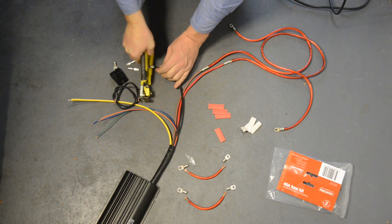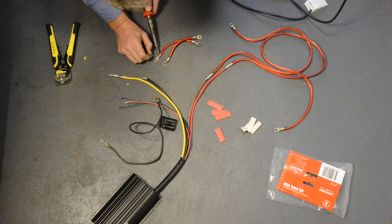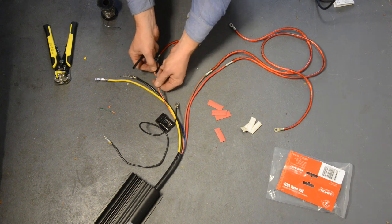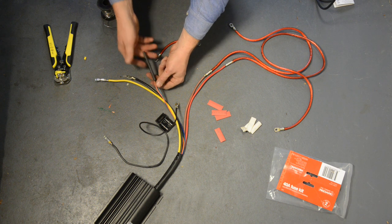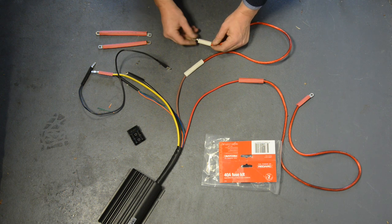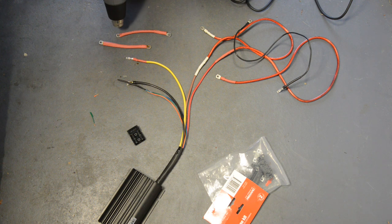Attach another heavy I terminal to the charger's black negative cable, and create two small loops to run from the positive battery terminals to the fuse holders, again using the same heavy crimp and solder terminals. For this installation I don't need to connect the orange, blue or green wires, so I'm cutting them off to slightly different lengths then encasing them in heat shrink tube — refer to the charger manual to see if you need to use these wires. You should then put heat shrink tubing over all the joins and terminal connections on the cables to help prevent shorts and keep water out.